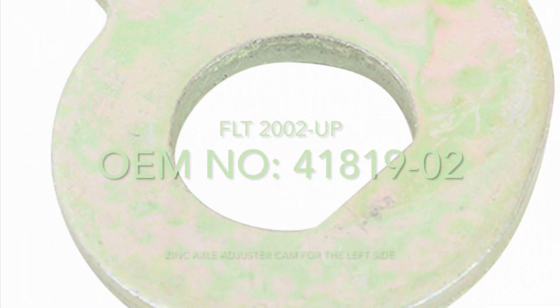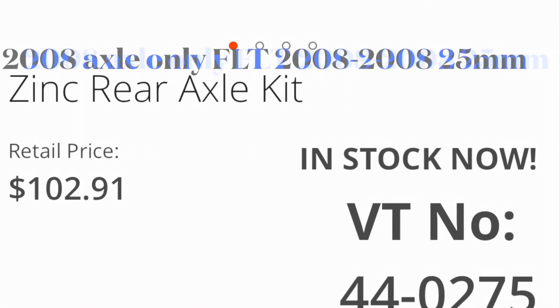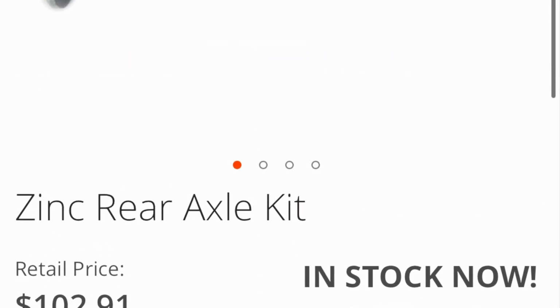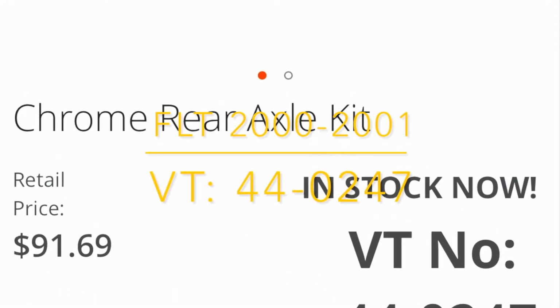Finally, for '02 and up, I think the axle is also an overlooked wear component. You have 700 pounds of force on a touring motorcycle being supported by a tiny zinc cam adjuster that likes to snap off. And if you're doing a swing arm kit, you might as well replace the wheel bearings every 30K for 2,000 and up sealed ones.